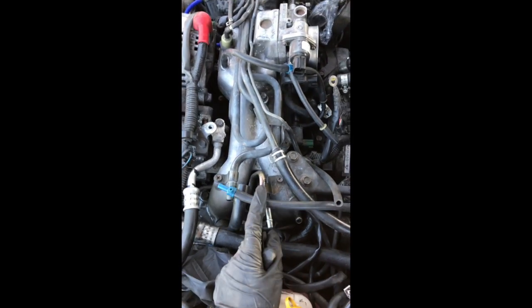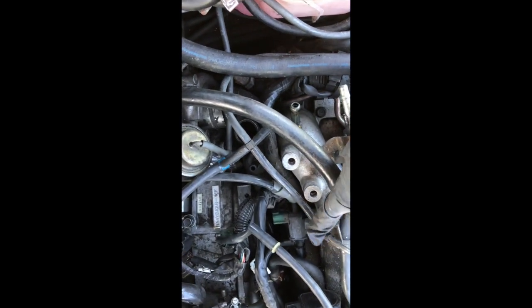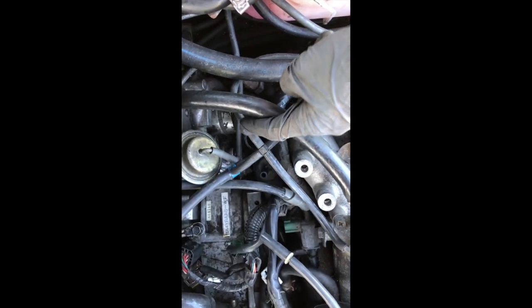I'm going to remove the intercooler bracket next. It's not that it's necessary per se, but I think when it comes to lifting the inlet manifold out it could be tricky, so just to give me a bit more room I'm just going to whip those two bolts out as well. Next I'm going to remove or disconnect pipe 10 that goes into the wing here from the myriad of T-pieces that goes to the rest of the vacuum system.